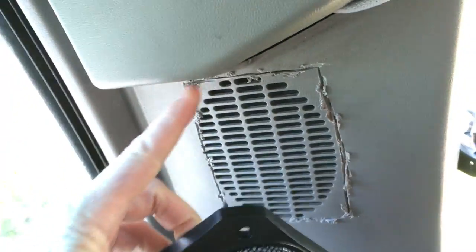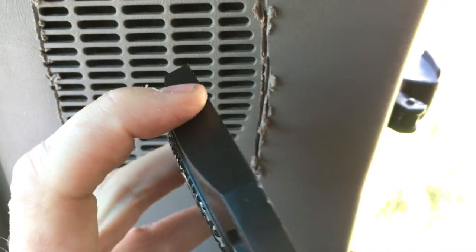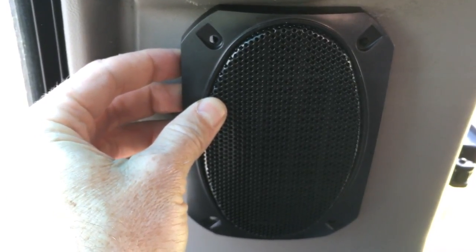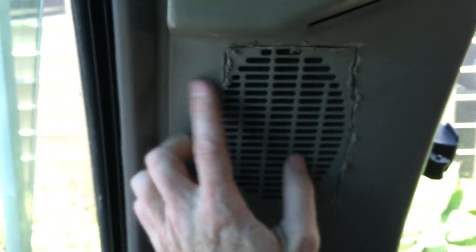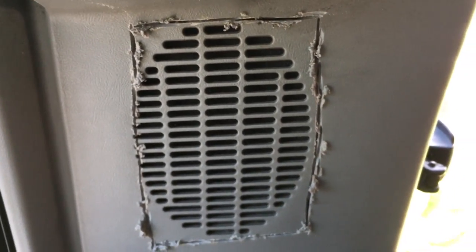The tricky part with this grill is this seat belt protrusion. You can see that it doesn't want to lay flat because it's going to bump into where the seat belt comes out. So we probably have to grind off some of this in order to get it to ride right over the speaker. The other option would be to get a bigger size speaker grill and put it over this. Or if there was just some kind of self-adhesive stick-on grill, that would be ideal because then we wouldn't have to worry about mounting it with screws or anything else.